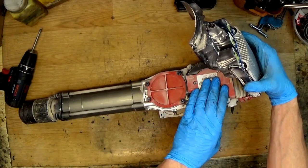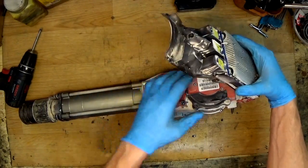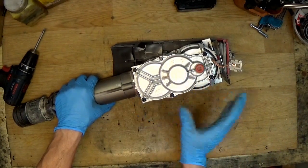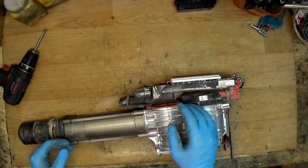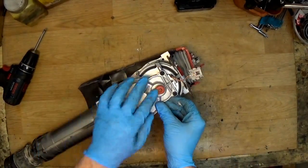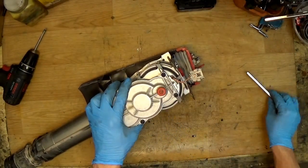What we have here is a magnet for the clutch and the armature. We have two ways — we can unscrew the screws and take the cap out, or unscrew this cap and fill in some grease. There's not a lot of grease inside. I think we'll start from the red cap here, because Hilti grease is really like a liquid and gets out very easily.